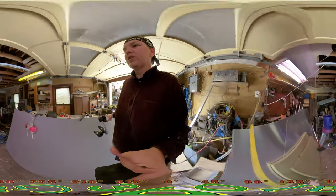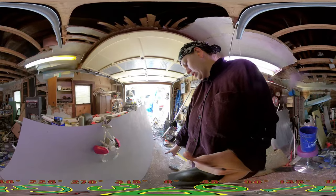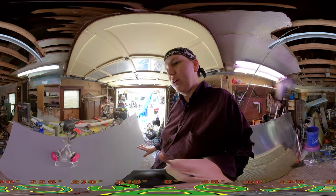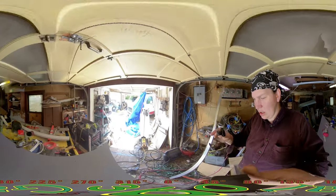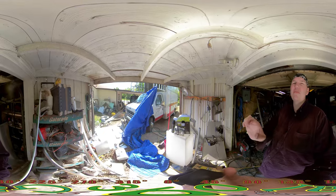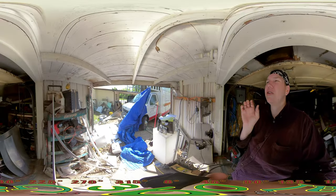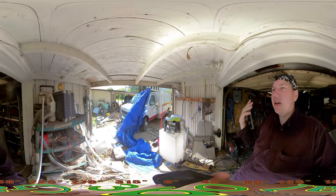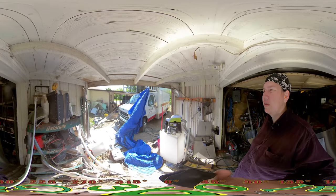So we're going to get back together building this out. I got this marked out on the corners here and a spot down there. So I'm only going to paint the area just above the cab area, black, I think. That's the best thing. So I can get this painted, get the cab area painted, and then we can get this up there and weld it into place. The main reason I'm not going all the way to the edge, for one, I want to run a trim piece along there. I don't know where that's going to go. I don't know if I want to paint it or not. For two, it gives a little bit of heat dissipation for whenever I start welding it up there so it doesn't cook the paint off.